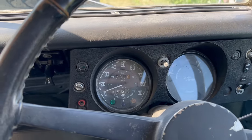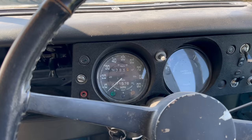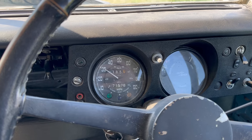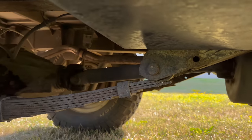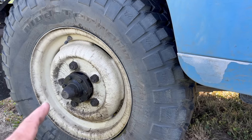My speedometer is moving. Put it in fourth gear — you can see it thinks that we are moving. And if we look under the vehicle, you can see the prop shaft is turning, which means I have probably broken one of the half axles.